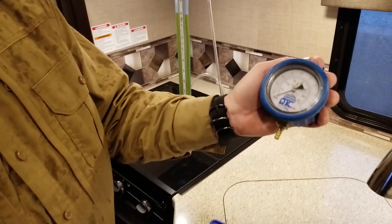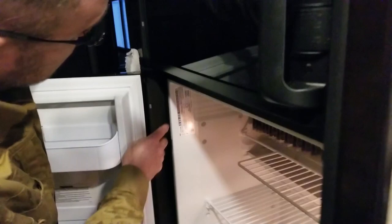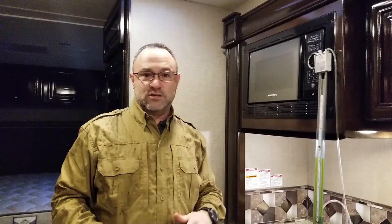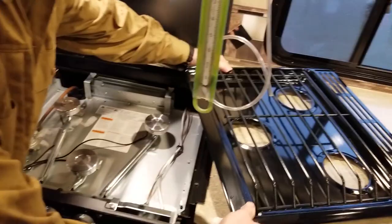What is this 'inches of water column' thing? On this refrigerator it says: equipped with LP propane gas, manifold pressure, 11 inches WC. If we go outside to our water heater, we'd see another sticker saying 11 inches WC. If we open up the stove top, we're going to see a sticker — manifold pressure, 10 inches WC.